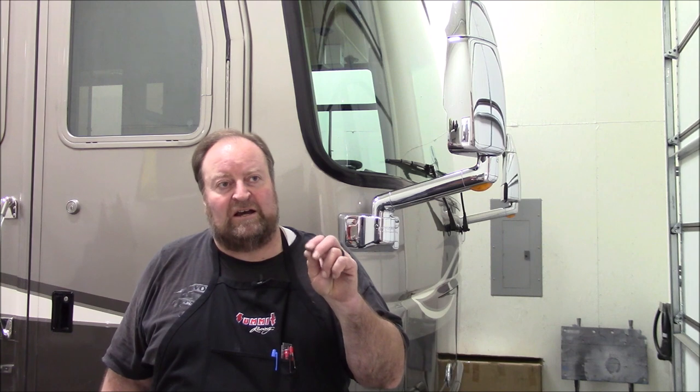I've been seeing on some Facebook groups and forums where people are starting to have problems with their skylights from around 2002 through about 2008. I have not had any problems with mine, so this is completely proactive and preventive. I don't want to be on the road and have a tree branch or hail ruin my vacation. The skylight is getting a little brittle — right around three of the four corners there are some really fine spider cracks from UV, and it's pretty chalked out. Other than that it's not leaking, so I'm just going to pull the old one off and put the new one on.